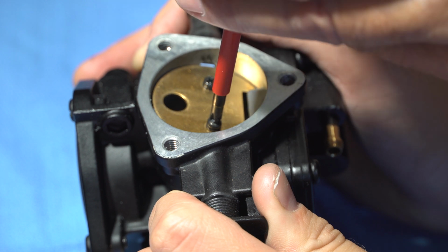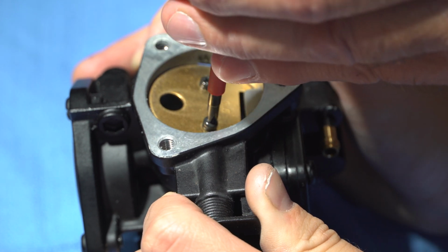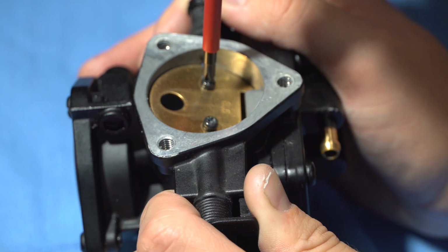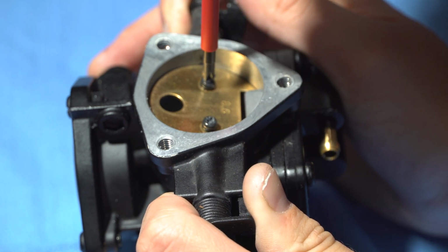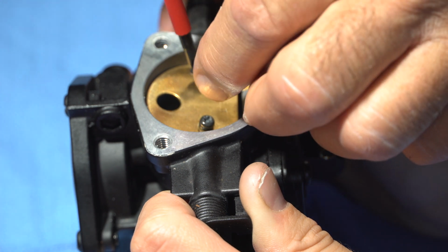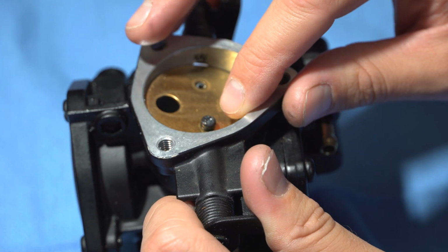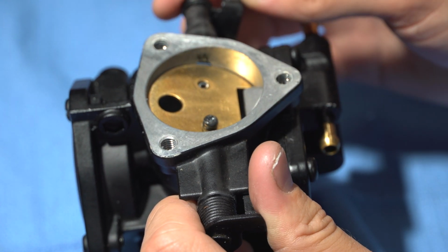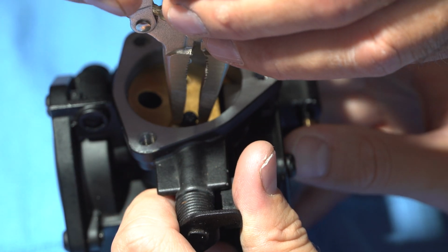The first carb we did, we got one fully out, and then the other one snapped about halfway. So we had to do a little bit of grinding. Yeah, so one came out good, the other one stripped out, and once they strip out even a little bit, they're pretty much shot. You can't use a screwdriver on it anymore. So we found that you use vice grips and an adjustable wrench to get the screw out the rest of the way.